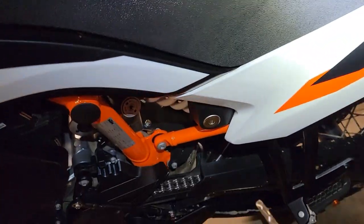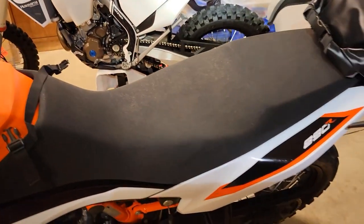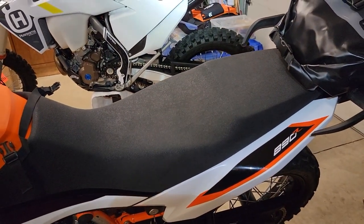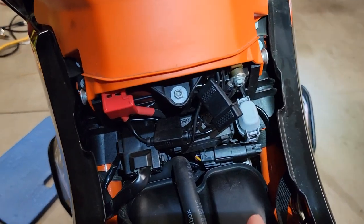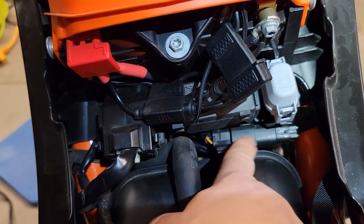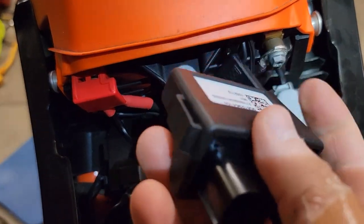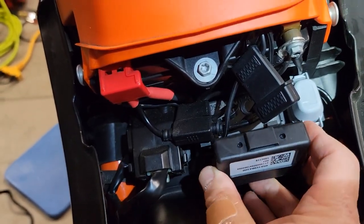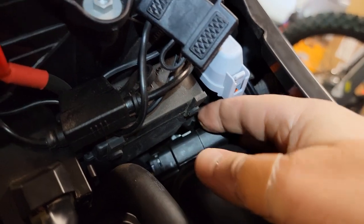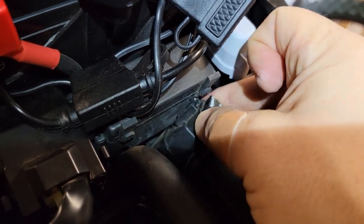Removing the seat — you guys know how to do that. It appears this is the dummy plug I'll be unplugging to install the relay module. The relay piece sits on a bracket right here; I pushed it to the right and it popped off with just my fingers, no force needed. This wire is going to plug into the bottom of the relay, which will sit countersunk up against the existing fuse box.